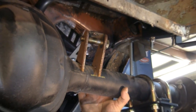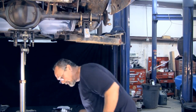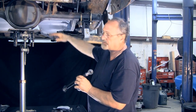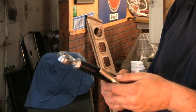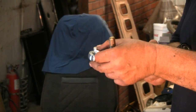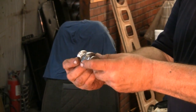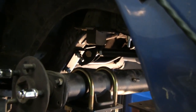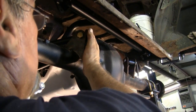We don't have the engine and transmission in there yet, so setting up perfect pinion angle is not an option at this point. That's the beauty of the adjustment on your upper arm — we can come in and move it in and out to adjust our pinion angle to line up with our driveline. For the upper control arm, put the adjustable end towards the front of the car. Before you put your bolt in, you have two shims — spacers — that go on. The smaller end goes towards the arm, and the bolt goes through the bracket into that. Feed that through, with one on the other side as well. That completes the install — we're going to come back and do some welds, then take the arm off and finish welding so we don't put too much heat on the bushings.